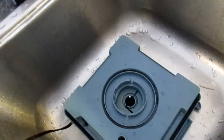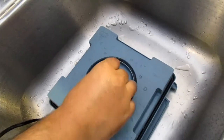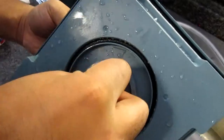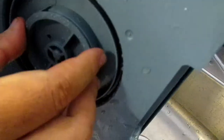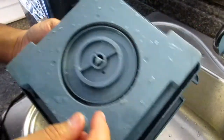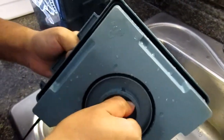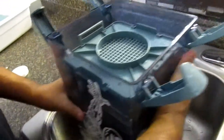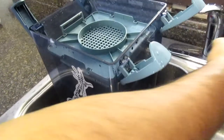and put my shaft back in the pump. Push it back in there. Then put the magnet back in. Grab your top, push it down, and twist lock it to the right. And that's it, that's locked in there. The canister's all clean. The pump is serviced and the pump is cleaned and ready to go.